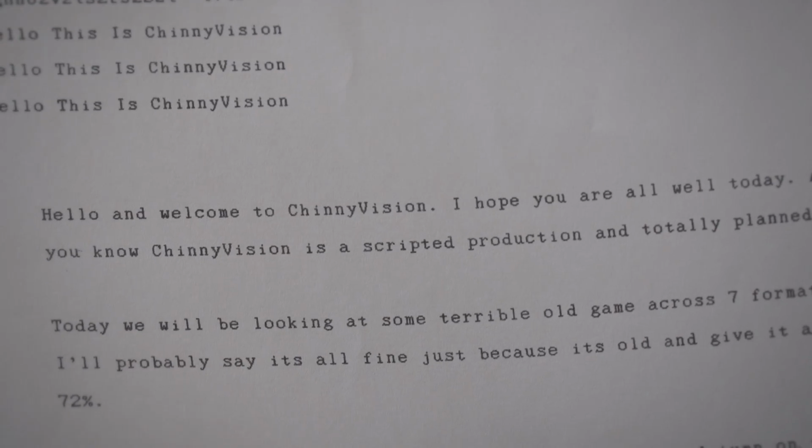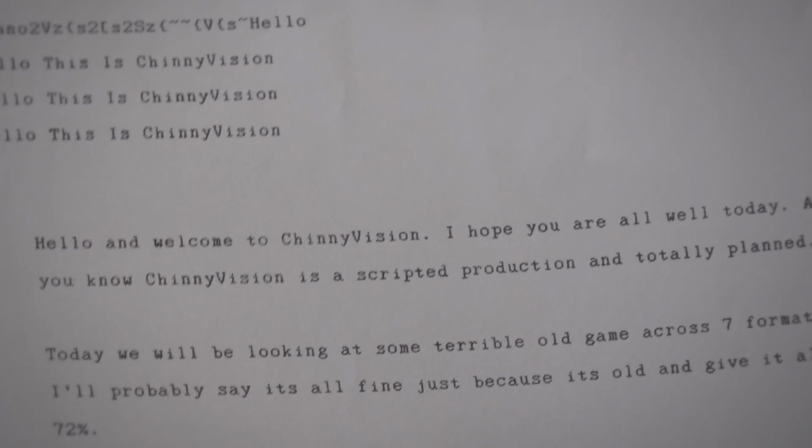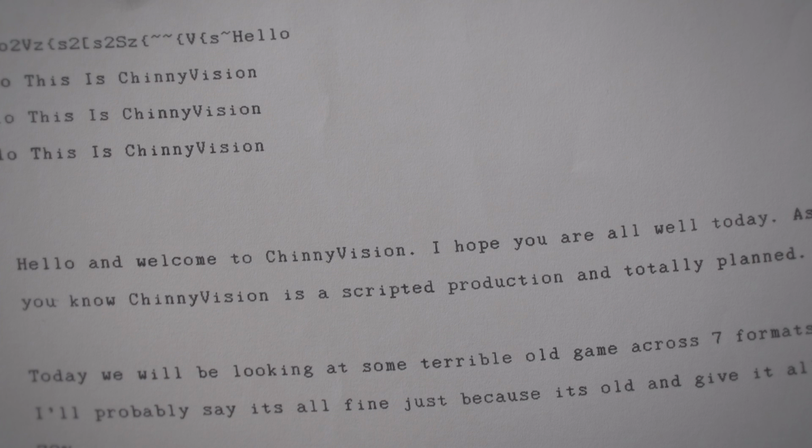You can see it's not the best print quality in the world. It's a 9x9 matrix at the end of the day, so it's going to be at very limited resolution. I think that this isn't draft mode. I think this is normal mode. I think you can have software that can also do more passes as well. In fact, I definitely remember there was one product available. Amstrad actually used to advertise it, that would do like 8 passes across your letters to give really good quality on these old printers.